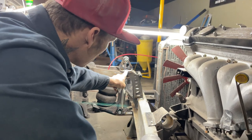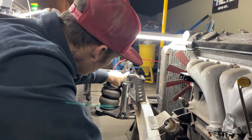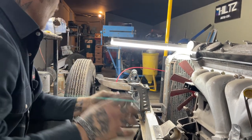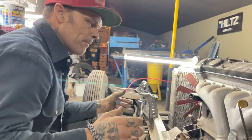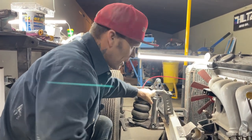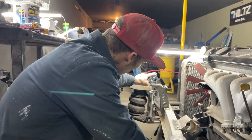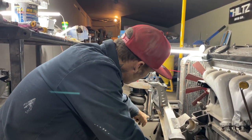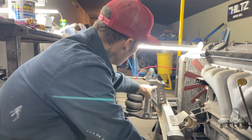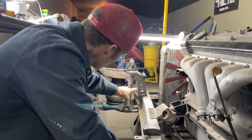When it came to this piece, then I had to change the top because I had one of these on the top of there. These are little brackets that come with the cross members that I buy. They shove on the tube, and then you can bolt them to the chassis. I had a couple here because I didn't use them. So what I did is I modified the hole up top for a half-inch hole. Now I got a shock that goes up in here, and I kind of like it because it got a big hole, got a small hole, kind of matches all this sort of stuff.